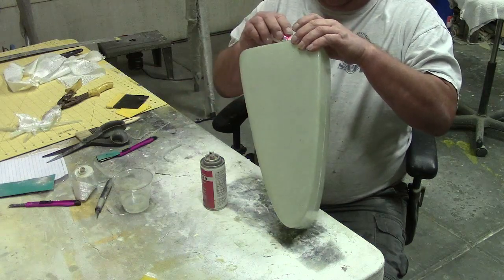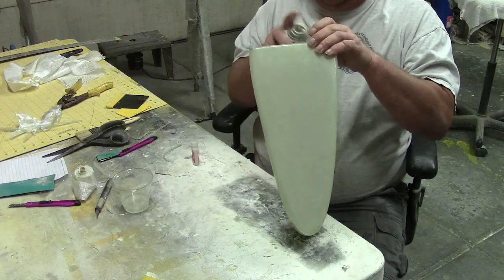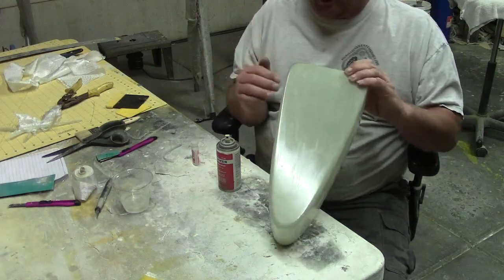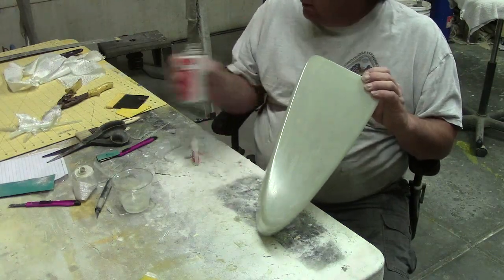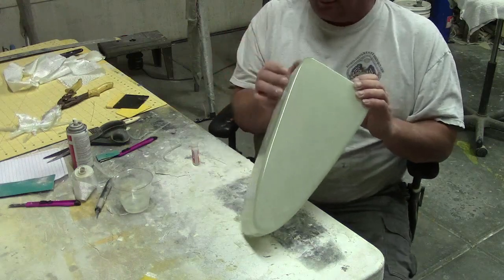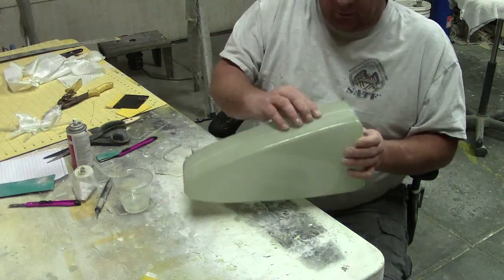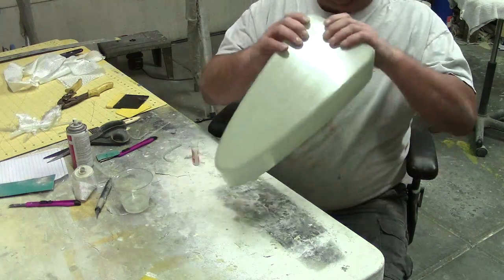These things, the pressure on your tank is when you're filling it up with fuel. Especially when you got more than one tank, you're pumping from one to the other. That's why I always use this great big brass tubing. I drill all them clunk holes out and put as big a tubing as I can get on them, and then use that extra jumbo large fuel line, especially with the P200s. I don't want no restriction.